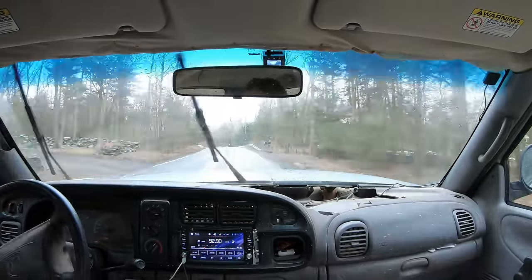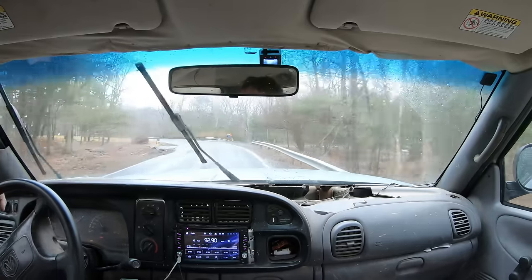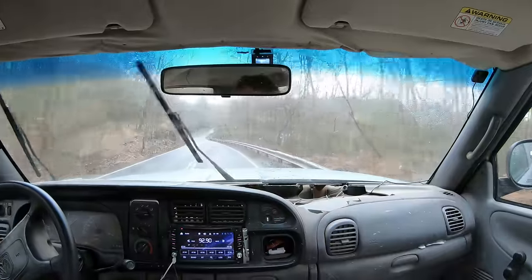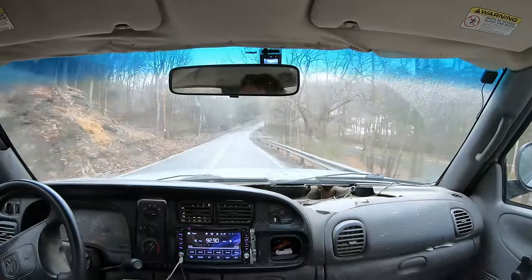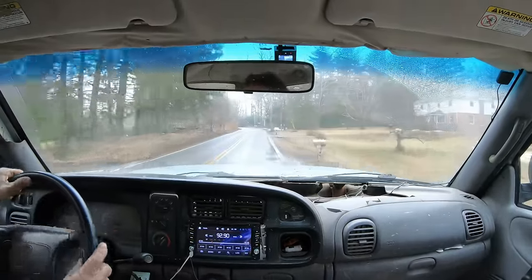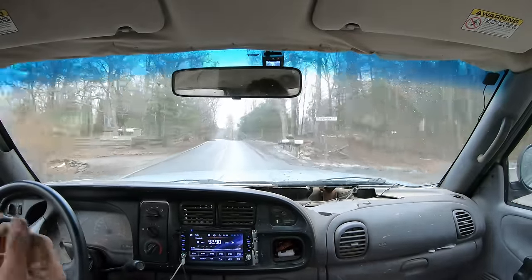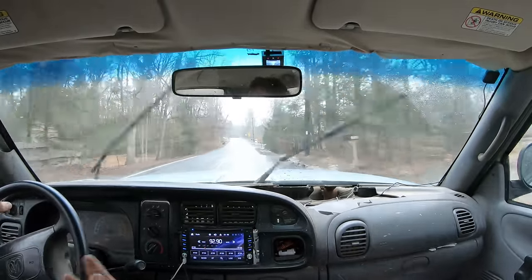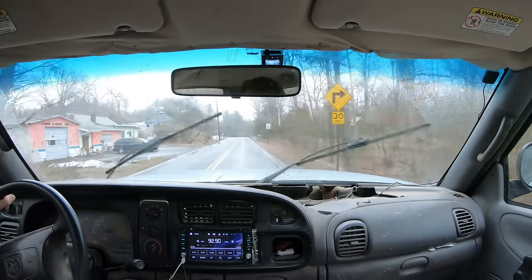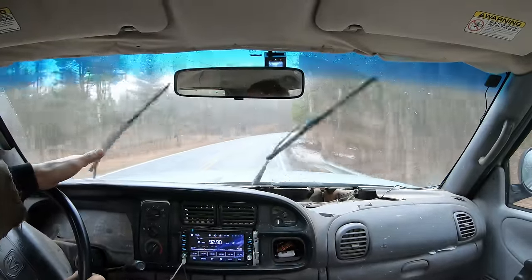But really, those copper nickel lines, those are the best. I've been putting them in everything because the steel lines are like a joke or something, and I've never had a problem, and they're not even any more money. Really, the vehicle should just come that way from the factory. I mean, you'll see these safety recalls sometimes, and it's like an issue that doesn't even exist. And they'll be fixing these cars, but these steel brake lines are a real issue. So a lot of times I'll see the rusty brake line, I'll change them even before they blow, because it shouldn't be steel in the first place. Think of rusty frames too, I don't know how the car companies are getting away with it, but at least Toyota, they were doing something about it.